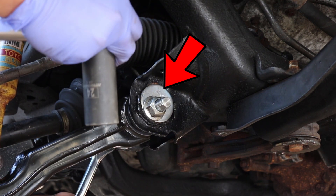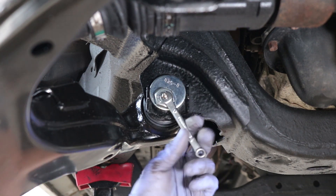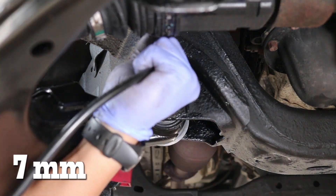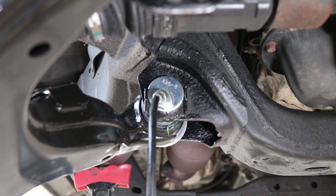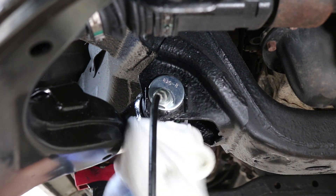The orientation of those cam bolts right now doesn't matter because you will need to realign the truck. Tighten down the zerk fittings with a 7mm wrench, then shoot some grease into those fittings until the grease starts oozing out of the sides. Make sure to clean up any excess grease.